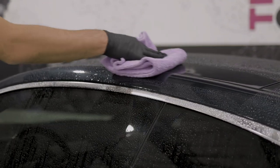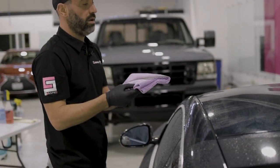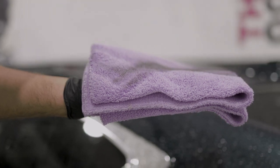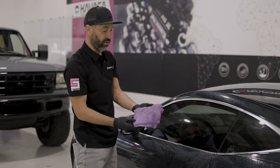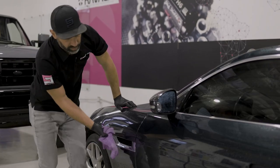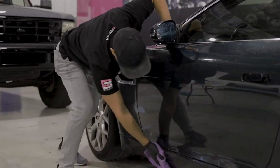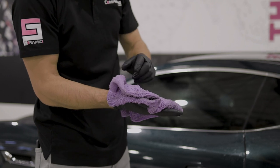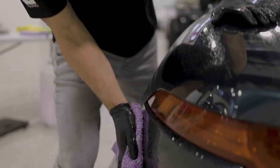You would never think, if you're an old-school car washing guy, that you could just literally spray a solution on the vehicle and then wash it. But with a high-quality towel like this and the no-rinse solution, you can safely remove this dirt without scratching the car. I'm working from top to bottom, monitoring the towel to make sure it's not getting too dirty, because typically there's more dirt at the bottom of the vehicle than at the top. I'm also intentionally not drying it all the way because I want the paint to stay lubricated. A nice lubricated paint with a high-end plush towel means you can safely wash without scratching. And if you have to, squeeze out some of the water and get back to the dirty areas.